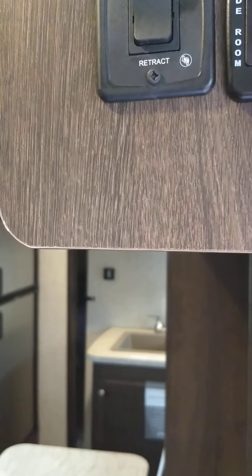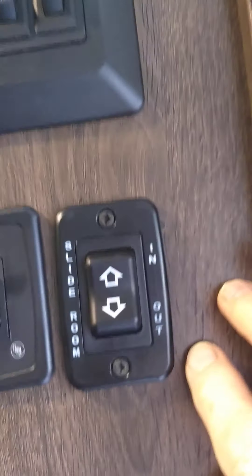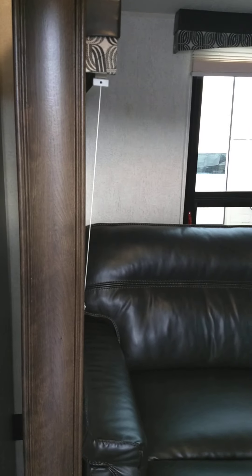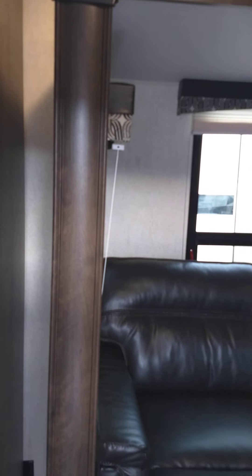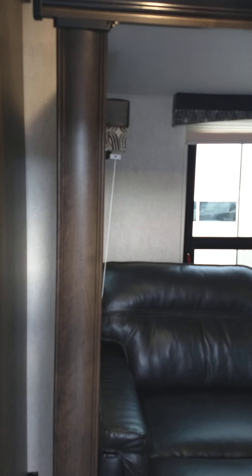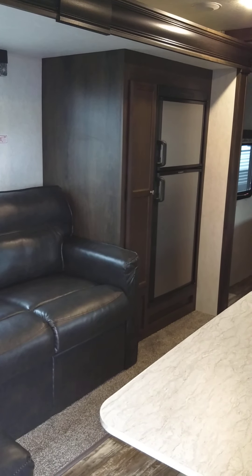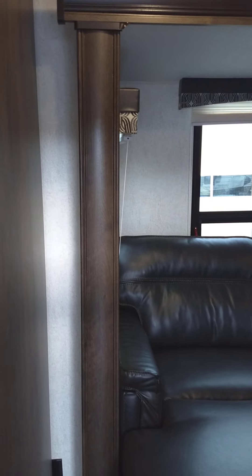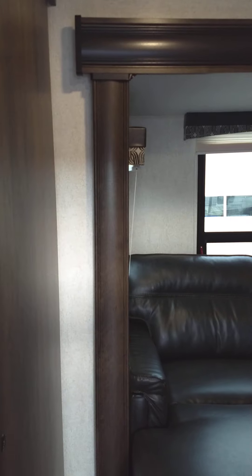You've got some lights, and you also have an LED strip on your awning right there. Your slide out is here — it runs off of the battery. If you're parked somewhere and just want to get back there to use the kitchen, refrigerator, or get into the bedroom, you just have to bump it out without plugging in. Let it go out until it starts ratcheting — that keeps it from overextending or over-retracting.